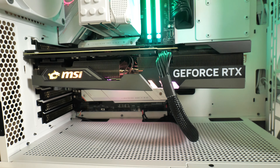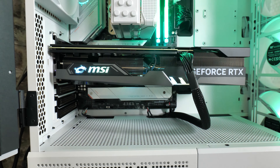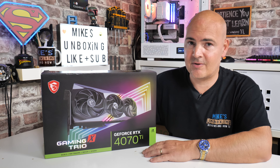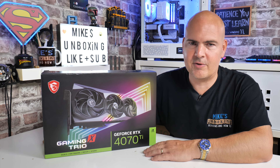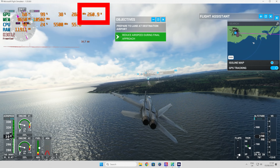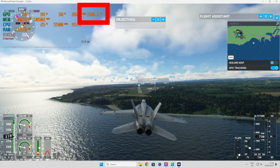If you're wondering what power supply you need for a beast like this, MSI recommends a 700W power supply, though NVIDIA recommends slightly less at 600W. This is a factory overclocked version so MSI is being cautious. Realistically, you're looking at around 250 to 285W draw in normal use, but accounting for power excursions which can momentarily double that requirement, the 600 to 700W recommendation does make sense.